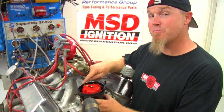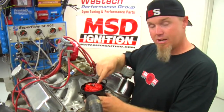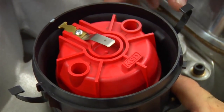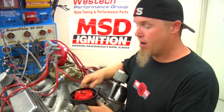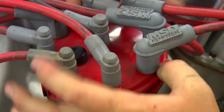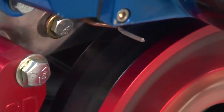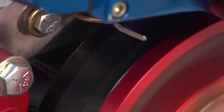Remember when we told you earlier that you needed to mark the cap and your rotor location? This is why. Now that we've reinstalled the distributor and locked it out, we need to phase the rotor. Here's our mark, so we're going to put it right in the center of the rotor when it's in the number one firing position. Once the engine fires up you're going to notice that the timing is rock steady. In our case we're dead on 30 degrees and the timing doesn't move at all. If you'd like a little retard to ease cranking during startup, MSD offers a full line of timing control units. If you have any other questions about installing a crank trigger or any other ignition system product from MSD, check out msdignition.com where we have a lot of videos that will help you out.